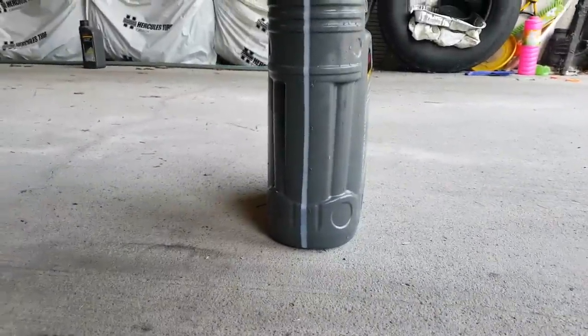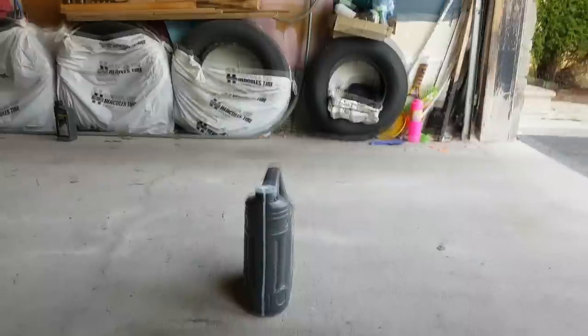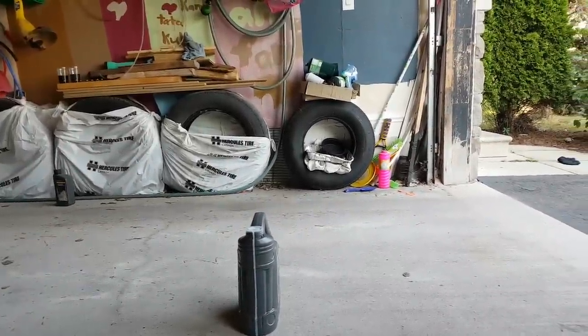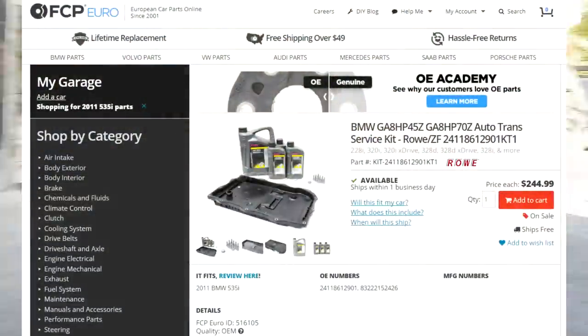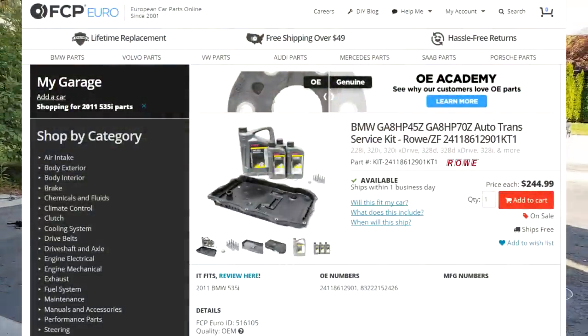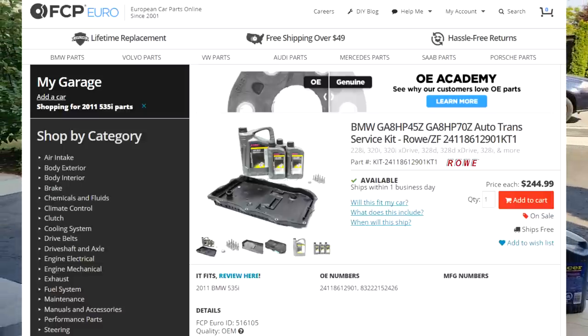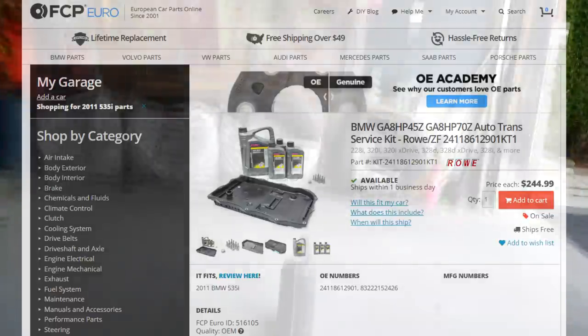I don't think there's a way on this car to put it into neutral without starting the engine. I accidentally started the engine and quickly got the car off the ramps. Now I'm going to jack up the passenger side and should be able to fill the rest of the fluid in. The car is jacked up very high — that should create an angle where I can fill through the fill hole on the passenger side. I was able to put another almost two liters in, so I only have exactly one liter left in the bottle — meaning four liters total in so far.